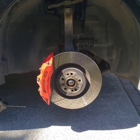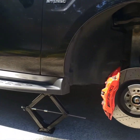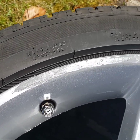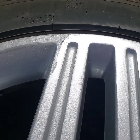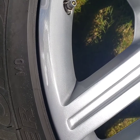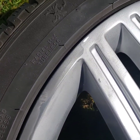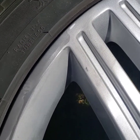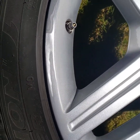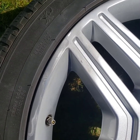I removed the wheel so I can avoid any overspray when I finally spray the wheel paint on. This is what it looks like with it cured on there. I just need to sand that, get that smooth, and then we can paint. I went from about 120 to 1,000 grit sandpaper. I'm just going to clean this up now with some cleaner, and then we'll spray after that.